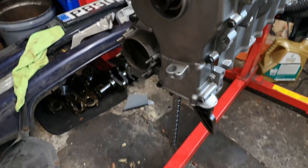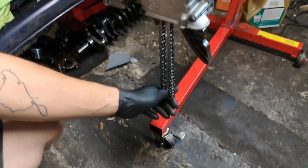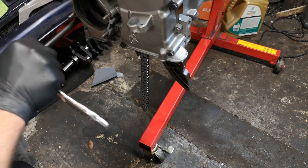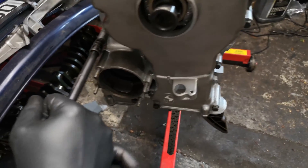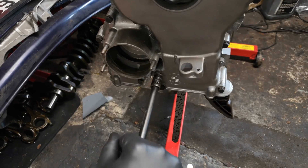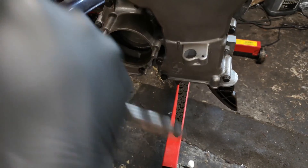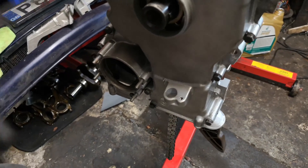Timing case cover is on. The main thing I've got to be careful about is not dropping the timing chain down into the timing case cover when I turn it over. I'll wire the chain and guide it through the head using some copper wire as a long extension so I can't drop it. The chain is loose around the sprocket at the bottom right now. I went all the way around the water pump area and made those ones tight first because I really don't want oil mixing with water. Then I tightened from the inside of the case outward to keep it all even.